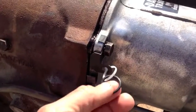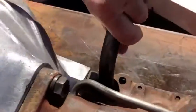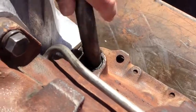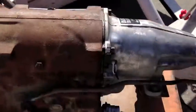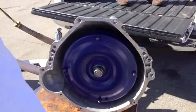Oh look, he included a seal for the speedometer. Do you guys remember how hard that was to get out? You couldn't budge that, could you? When these come in frozen — oh my god, they're a bear to get out. Now there's a new o-ring on here, it's greased, and you can actually move it and take it out when you install the trans. Before, this thing wouldn't rotate or do anything.